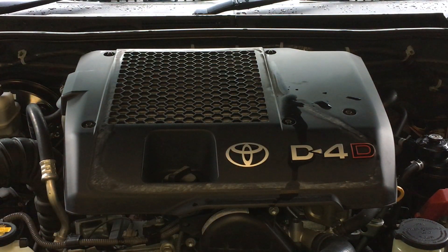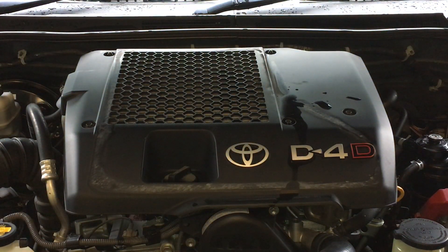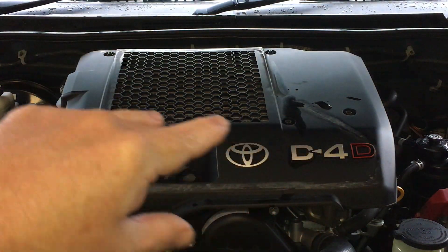My point is: driving in the rain, a small amount of water will push up through the bonnet and go into the bug catcher and come in here — that's not actually a problem. It's really good; you'll get better performance in the cold and in the rain because that bit of water coming through and down onto the intercooler helps with cooling and the system works better. Where it could be more of a problem is river crossings, and I've noticed a lot of people like to hit those hard and fast, which isn't necessarily the best approach.